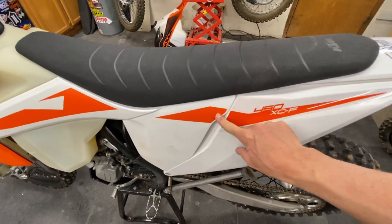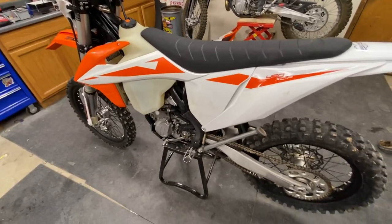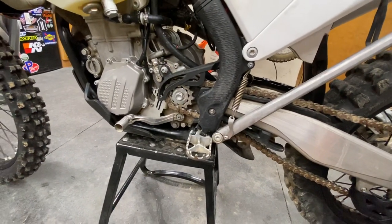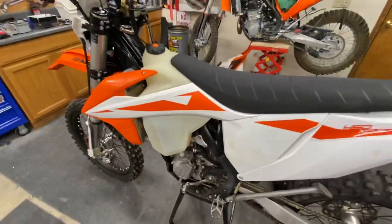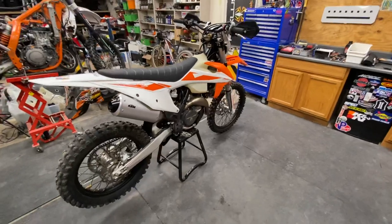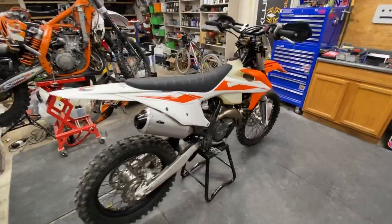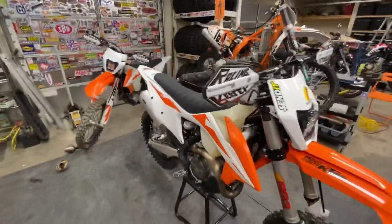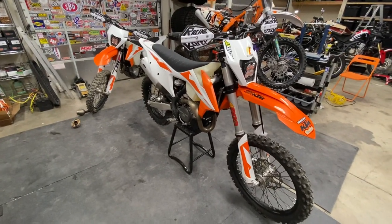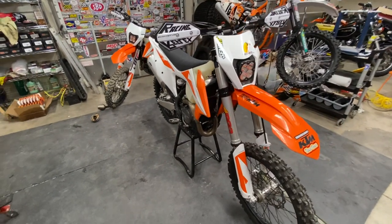That gives you a window into what a 30-hour bike looks like. I don't see anything else that's really problematic — you've got typical wear scratches on the side panels, the chain and sprockets are wearing really well, and I don't have any issues with any of that stuff. For the most part at 30 hours these bikes are holding up really well — no issues, breakdowns, or concerns whatsoever, just that one thing with the side plastic. These make really good Baja and overland bikes. One thing to note if you're looking at a dual sport conversion with one of these XCF bikes: the 350 is a six-speed but the 450s are five-speeds.